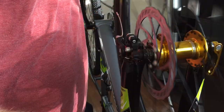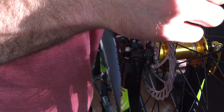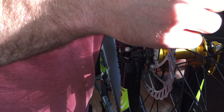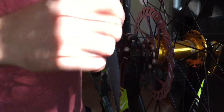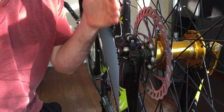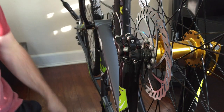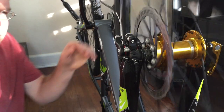That's pretty good. The other thing you want to check for is bending the rotor when you engage the brake. That's an easy way to see if the caliper is misaligned, because I think when it came out of the box it was kind of caddywampus a little bit. What will happen is you'll see the rotor flex when you apply the brake. So all I did was move the back — the base of the caliper — out a little bit by backing off on that nut, and then we'll make sure there's no rubbing.